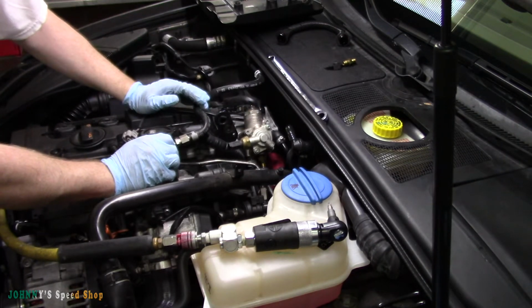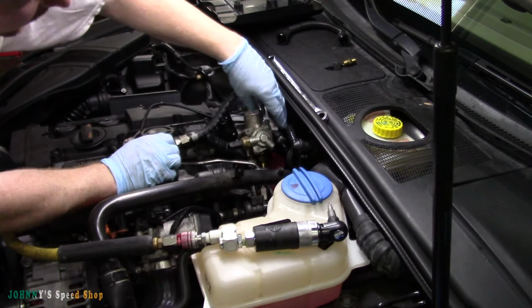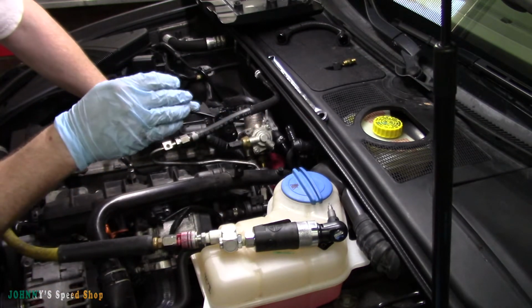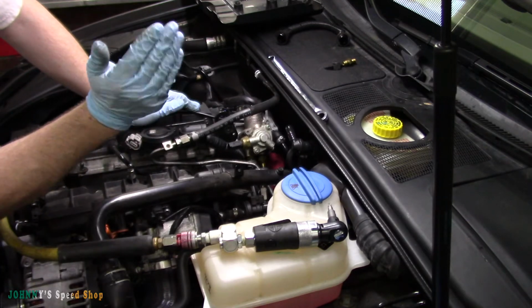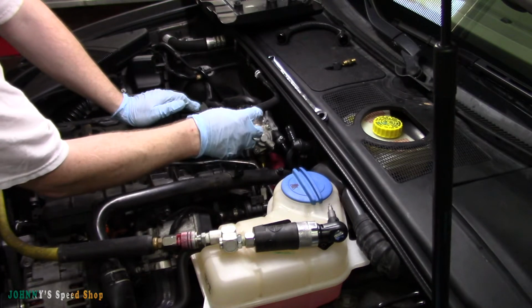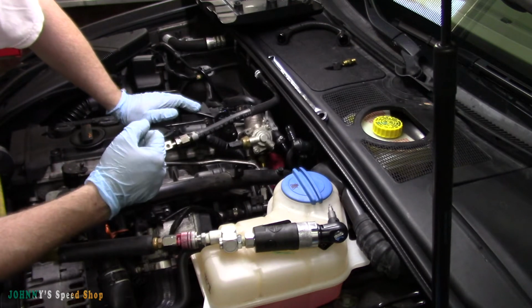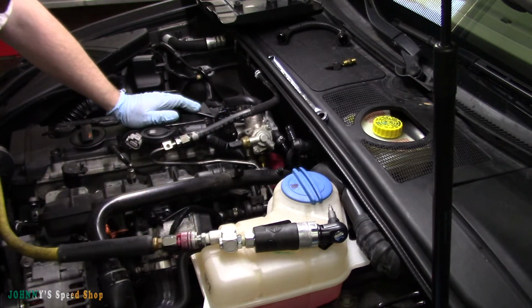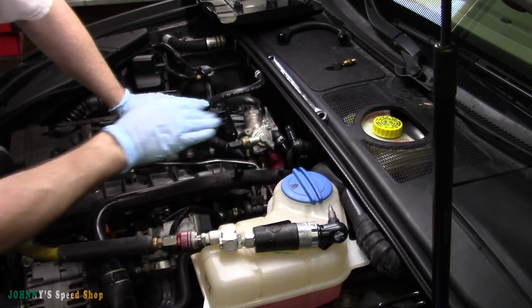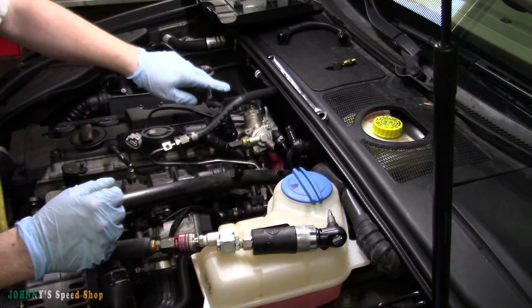So we're going to pull those three and cross our fingers that the cam is in a smooth position and not the lobe coming up. If the lobe is pushing the high pressure fuel pump at the moment, it's going to spring off and make putting it back on almost impossible, and we'll have to bar the engine over at that point. No big deal. Just in these cars, there's not much room. Hopefully it's on a smooth part and it doesn't spring out, and we can get it back in without having to deal with turning the motor over.